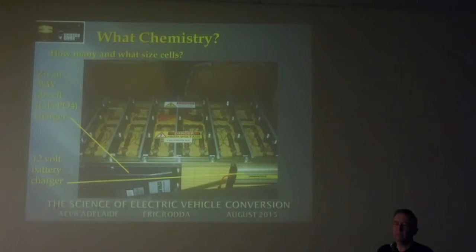And that's the only way you can bring them back, because once they're below the recovery voltage, these smart chargers that are designed to charge them won't put power into them. It just says, oh no, this battery's fine, and switches off. So an ordinary mobile phone charger, if you've got an old Nokia in the cupboard, that's fine. Just pull a little tip off the end and put a couple of alligator clips on, and then just be prepared to spend an hour and a half. Well, it just trickles it up above the critical voltage, and then you can use a little single cell charger, which you can borrow from people like me, and you can just bring that cell back up.